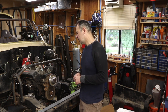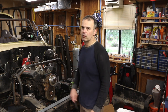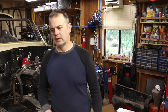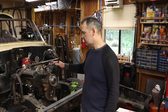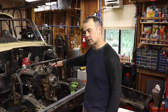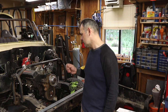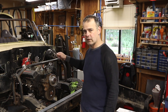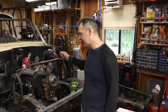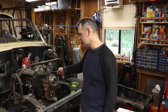I was planning on doing a mechanical fan, but I just can't get it to work without moving the engine way too far back into the firewall, which I don't want to do because I like having the room to work. It just doesn't feel right having the engine that far back — it gets the transmission shift tower way too far, gets the Dana 20 way too far back. Right now I've only moved this back about an inch and a half or two inches and up an inch.